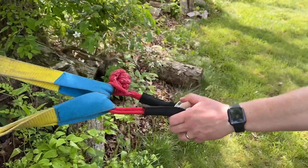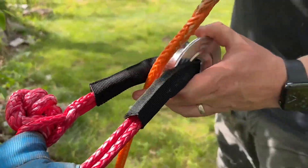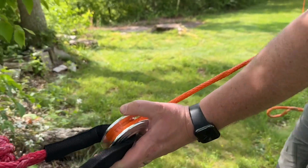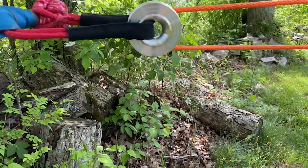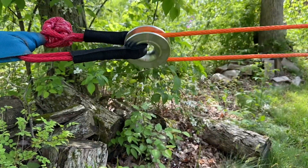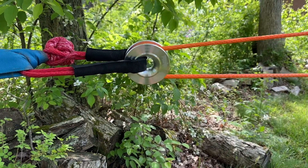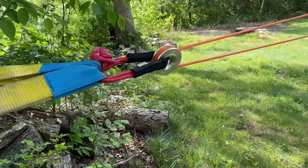The truck that we use off-road is almost 8,000 pounds, so using this ring as a pulley really helps to take some load off of the winch. Using this ring with heavy duty soft shackles over a snatch block also increases the safety of a recovery by reducing the risk of the metal snatch block or some other metal parts from breaking loose and hurting someone or something.